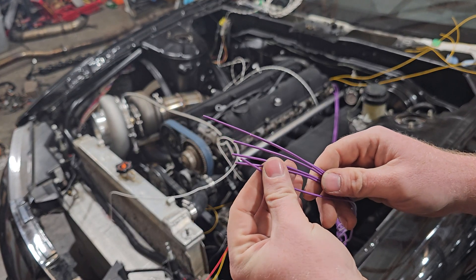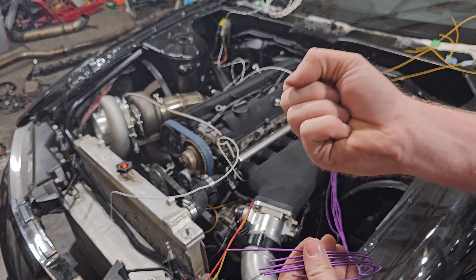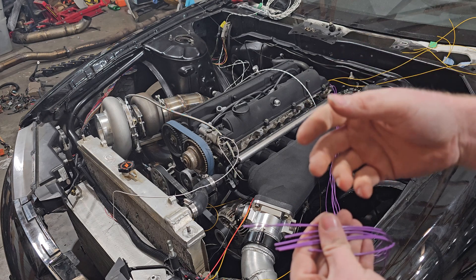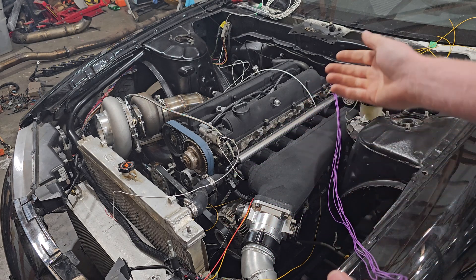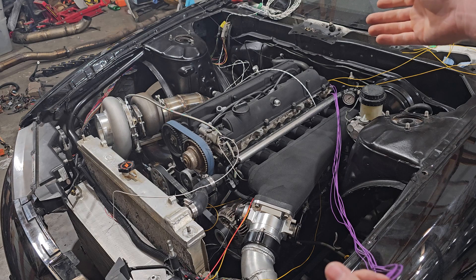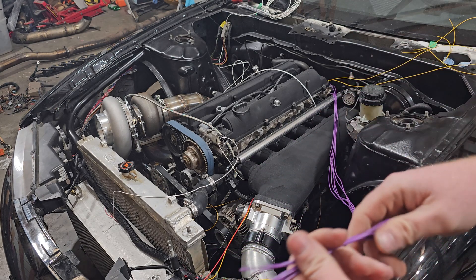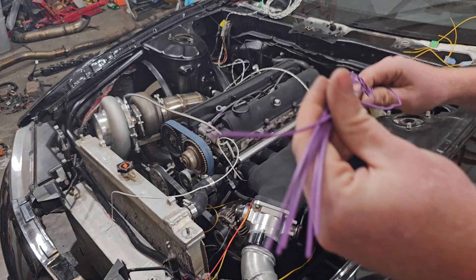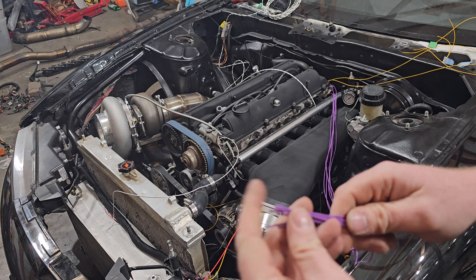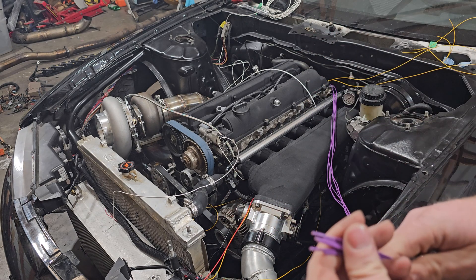It's not like an ignition system where the ignition system actually holds a charge and physically has to use the voltage. If you were to lead off of that and run six 12V wires to six ignition coils off one super thin 12V wire, it will burn up the wire because it's going to pull way too much load. So we're going to run this right through each runner and then snip to size after we pull everything tight behind the cylinder head.